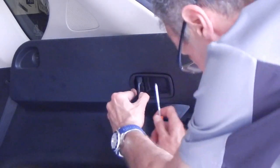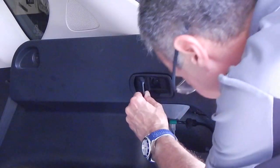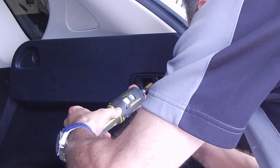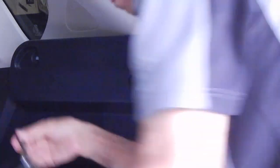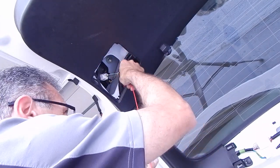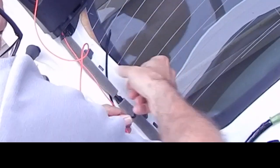Once you know where that wire is going and you've finished taking off all the panels, here on the side panel is where I'm going to mount the control unit behind. I have to remove some screws and one 10-millimeter bolt that holds the panel in place, as well as the clips. Then you can gently pry that panel loose. Here you can see I'm working on wiring the power lead from the backup light on the inside cover panels of the back door.